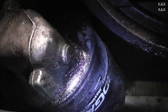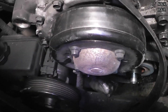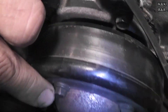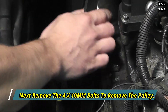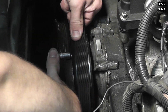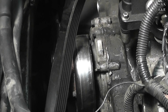After getting the balancer off, we're going to take the water pump off. We should have cracked the bolts while it was still under the tensioner, but that's fine. Right now we're going to bind the pulley and pop the bolts — those should be 10-millimeter bolts. Looks like someone already had a fun time with this: someone stripped a bolt because they were using standard instead of metric. You can't do that.